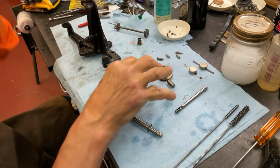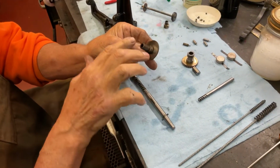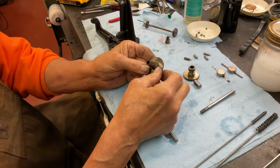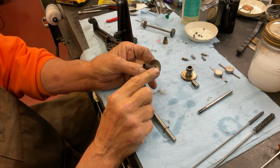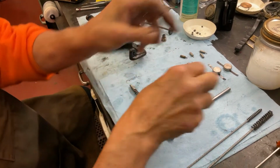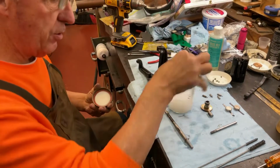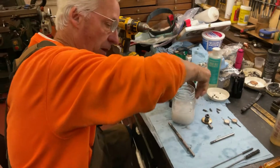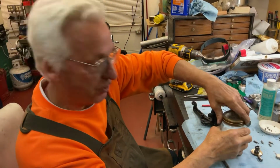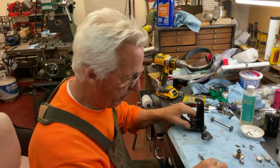One thing you want to look at when you take a governor apart is the back side where the little speed control yoke is with the felts. We see no wear in here, which is good. The other thing is you want to get the brass clean. So we will drop both governor pieces into sudsing ammonia, and I will come back tomorrow morning, and this will all be happy, shiny looking brass. Straight sudsing ammonia? Straight sudsing ammonia, just let it sit there. Not diluted at all? Not diluted at all.